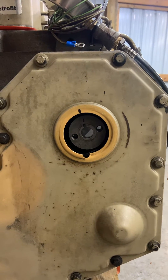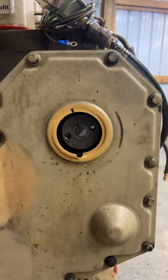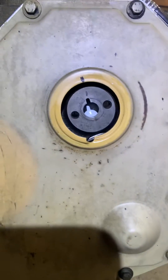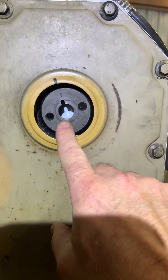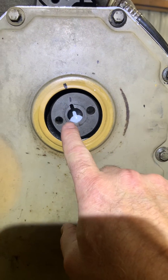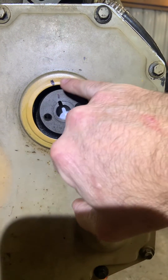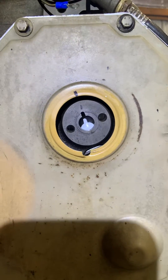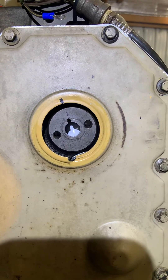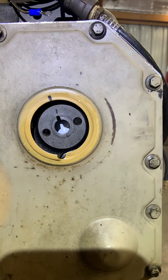In the back of your injector pump gear. So here's the front of the cover, and as you can see, there's your keyway. Your keyway is sitting just slightly off center. I've made a little mark here — that's where it goes right there. That is the position that your gear is going to be sitting at when you have your timing gear pin engaged in the back of that.